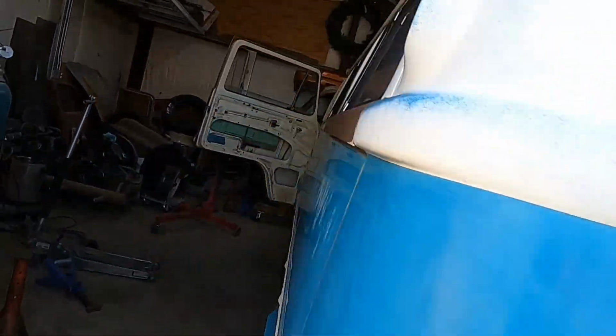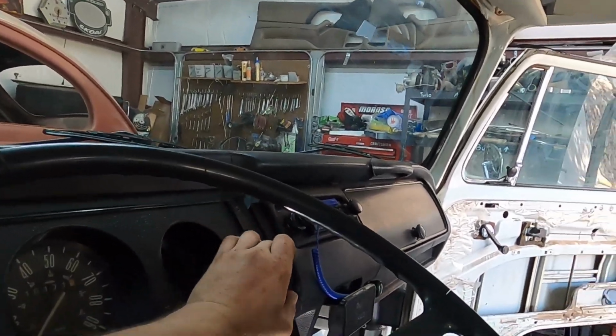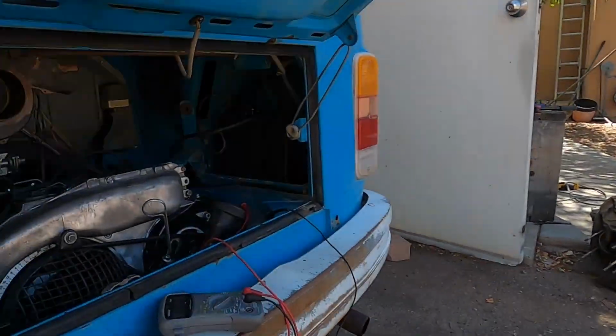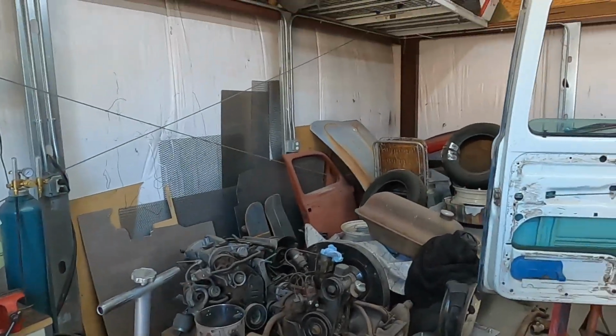So, you know, you go to the front, you put it all the way down, turn the key on. And you get a blower. Stuff is easy to fix and figure out. You just gotta do some diagging, guys. Look up some diagrams, trace some wires, you know, make sure there's continuity between things. It's not that hard. I mean, maybe it is, and I'm just used to it at this point with all these dang Volkswagens and cars. But either way, now we got a blower motor.